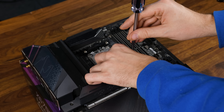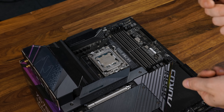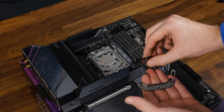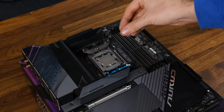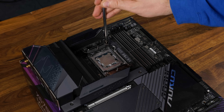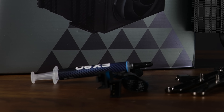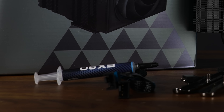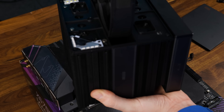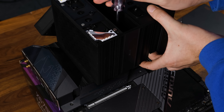Over on AMD, remove the original retention brackets and replace them with the exact same double-sided screws — how thoughtful. Then install the AMD retention brackets, again with the arrow pointing towards the CPU, and screw that down. On both sockets, you don't need any thermal paste as there is already some pre-applied on the base. Or in case of re-application, you can use the excess paste provided by PC Cooler. Take off the top cap, remove the central fan, and slap the cooler on there. After screwing everything down, put everything back together.